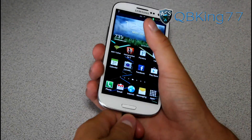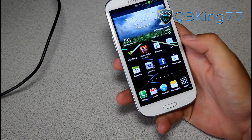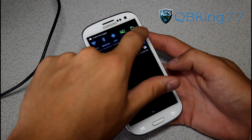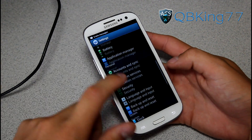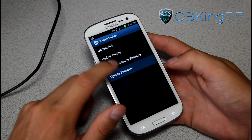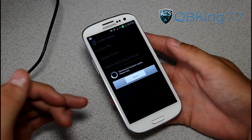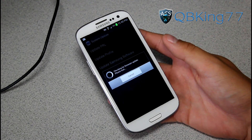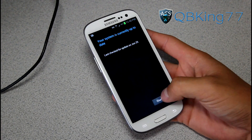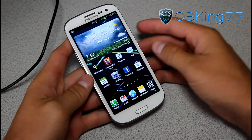My phone has just rebooted — you can unplug your device, you don't need it plugged in. Once it reboots, you're ready to go. Now, if you're getting the over-the-air notification, go into Settings, scroll down, go to System Update, and select 'Update Firmware' or 'Update Samsung Software'. Press it and it'll check for the update. Now that you have stock recovery, it should let you manually update via over the air.